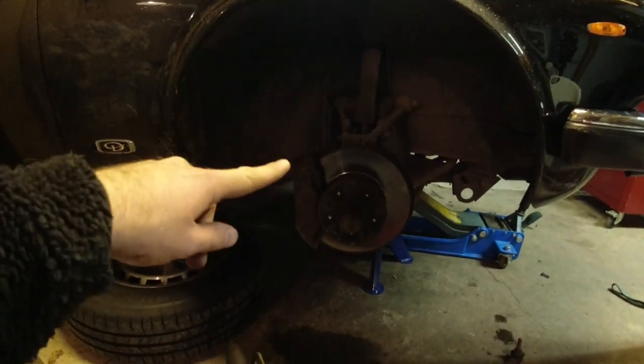Really, the other things I talked about are much more common. Those are the common knocking points and weird sounds from the front suspension. Of course it can be other things, but if you have a car that's usually nice and smooth and from one day to another you have some slight knocking, these are usually the culprits: shock mounts or the links for the sway bar or anti-roll bar. Very easy to replace — I've done a lot of videos, one of the first on the channel, like the fourth or fifth video, is on replacing these. So really straightforward and I'm not going to show you that again in this video.